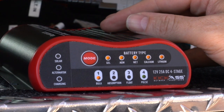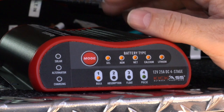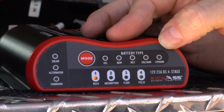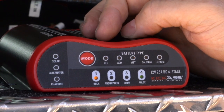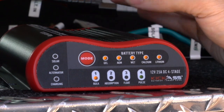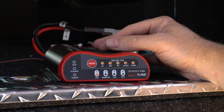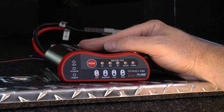A really good feature of this charger is the fault mode indication system. One important fault mode indicator is when you haven't got your auxiliary battery connected — all the top lights will flash and the bulk and pulse mode will remain on. This simply means your auxiliary battery has a poor connection or is not connected, making it easy to diagnose the problem. There are other fault mode displays which can be referred to in the user guide.